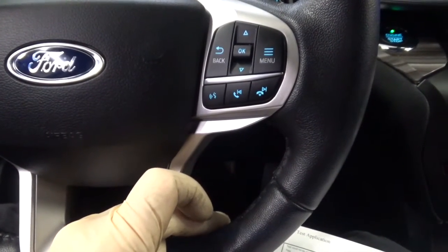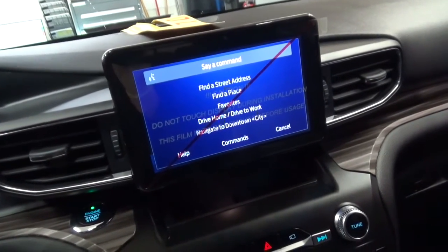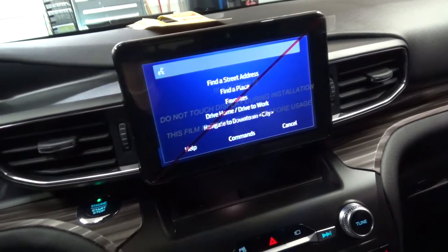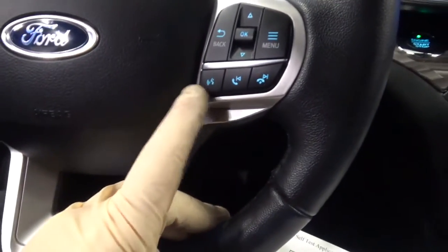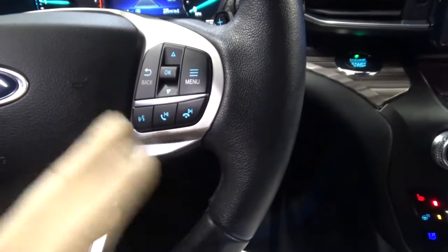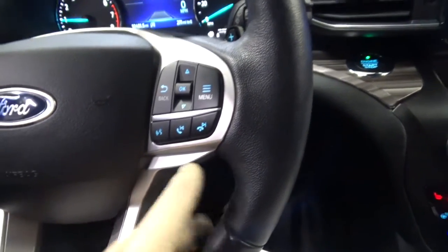Navigation. Please say a command like find an address or find a place. So a quick way to check your sync is just press the voice button and say a command like temperature, navigation, location, or something. And chances are if the APIM is working and you have this code, that display will fix it.